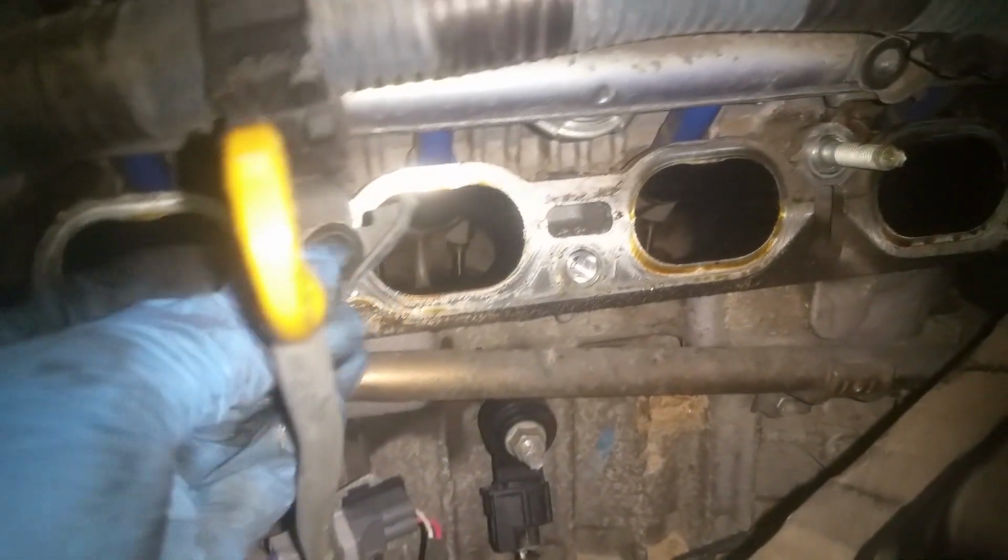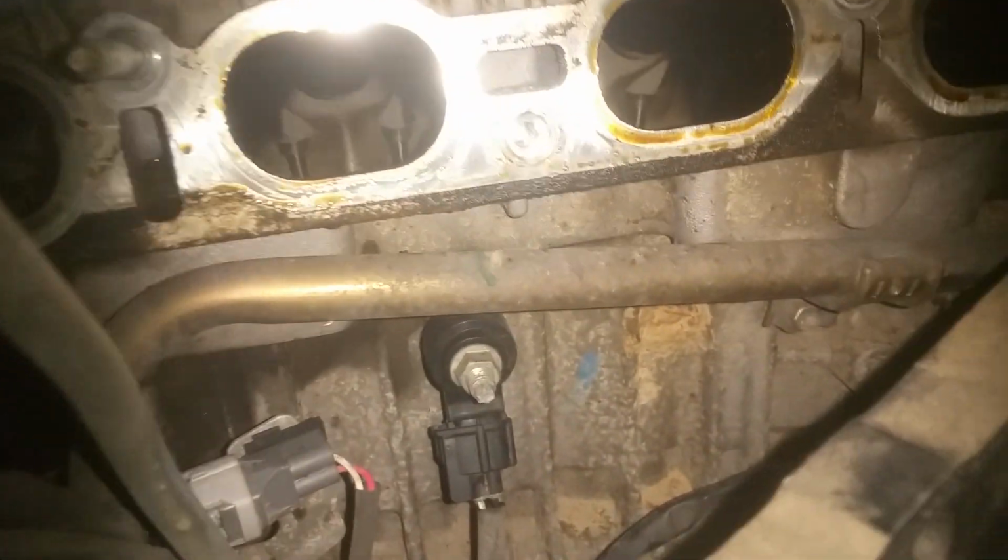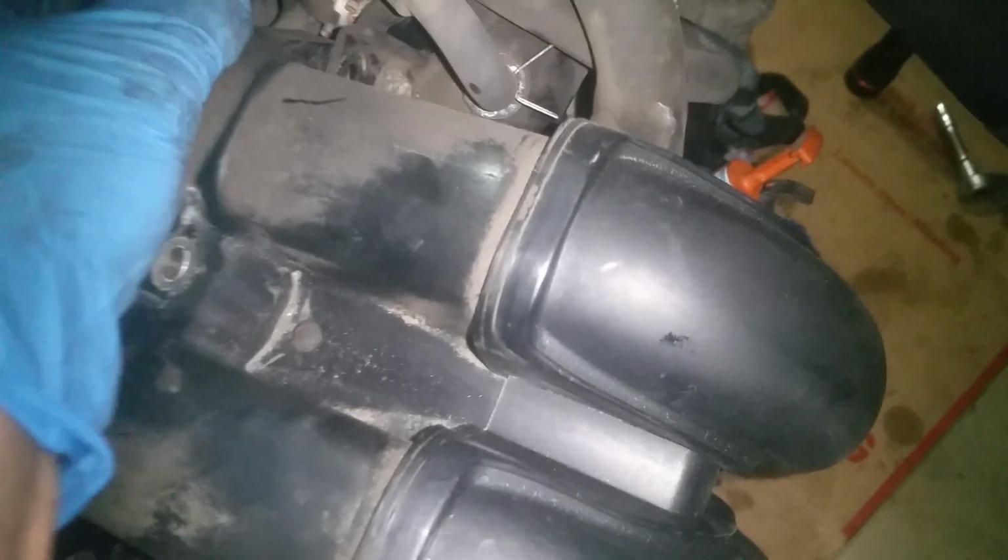And I just slipped it right up and over the top of the dipstick. These were connected to the stud bolts, and I just pushed them up for the wire harness. And now I'm getting ready to slip this old gasket off here, and it's got a tab, I believe, down here that you can grab a hold of. Maybe. Let me get a screwdriver. It's just stuck.